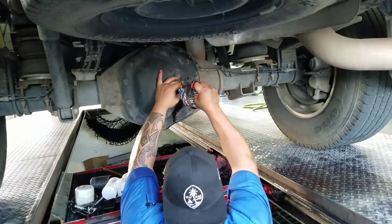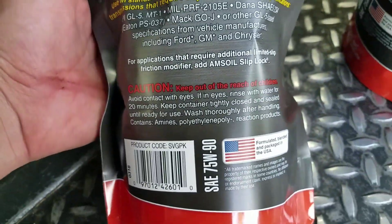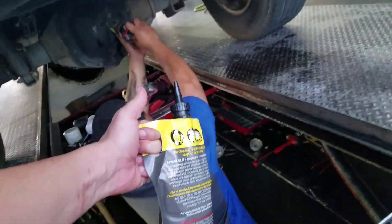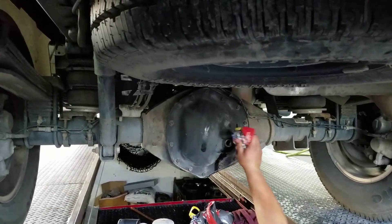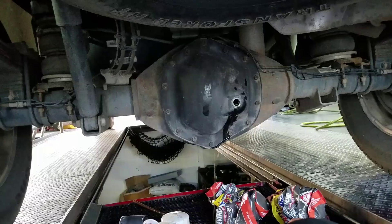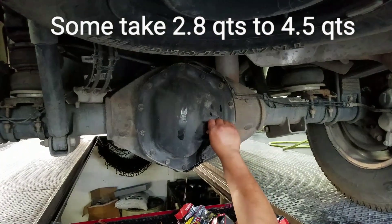Chris is squeezing in our Severe Gear, 100% synthetic gear lube. This rear diff should take about four or five quarts. What makes this different is it's 100% synthetic, so you have much stronger film strength, and it meets and exceeds all the specs for all the major manufacturers. It's a GL-5 specification. The packaging has a little loop, really easy to hold, and you just squeeze it in like a tube of toothpaste. Super strong construction. She's overflowing — we got about three quarts in. Some diffs take about three and some take five, depending on the size of the ring gear and the differential. Once she drains down, we cork her up.